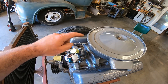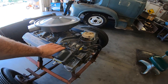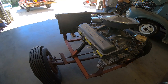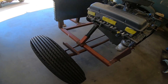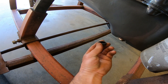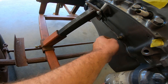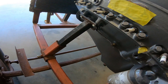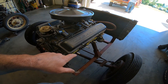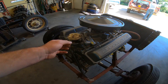Chrome breather cap. It's got the straight thermostat housing. Put the pulleys on it, untape everything, check it for spark. Maybe take the valve covers off just to see that we got everything looking good in there. It did say on a note that was on the engine when I bought it that it needs the valves adjusted. He's even got a neat little rubber cap that goes over his chrome oil pan plug — and pet cocks on the side of the block instead of your standard pipe plugs. It's got a new cap and wires, obviously not a new rotor but we might have something around there.